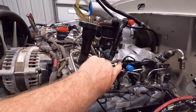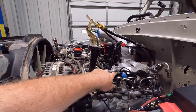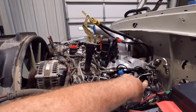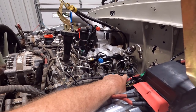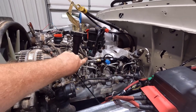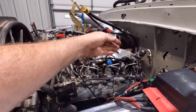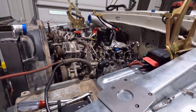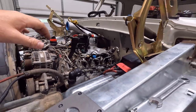Since I did that, it's out of the way. I'm going to drill holes in the firewall and get the brake booster mounted and sorted out. I also had to remove the crankcase vent filter — this big plastic thing right here. This is the crankcase vent filter that filters the oil out of the blowby. I'm going to run that down, and I think I might put it back into the exhaust so we don't have fumes. It shouldn't be very smoky because this engine has very little miles on it. I also need to get an internal catch can to keep oil out of the system, and maybe an external catch can to catch any drips.